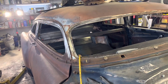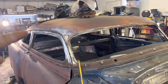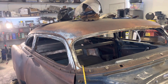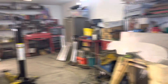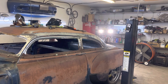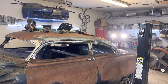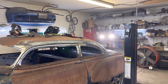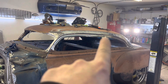We got a good arc along the roof, and that's a major important thing, because a lot of these frames they kind of arc down and then you see them arc back up. You want to make sure you get a continuous line up there that matches your roof line. There's a lot of work involved in that whenever you're chopping a top, because you have to change the position of things. So you want to make sure that your top line runs fairly evenly with the roof line — it's very important. Otherwise you get giant gaps and you can't adjust those gaps out if you don't do it right. It's very important to get that arc smooth all the way along.